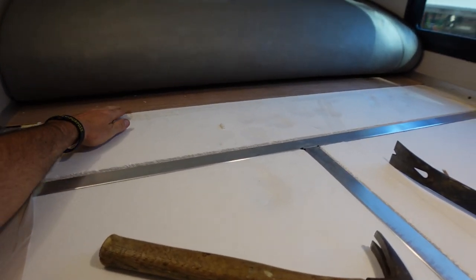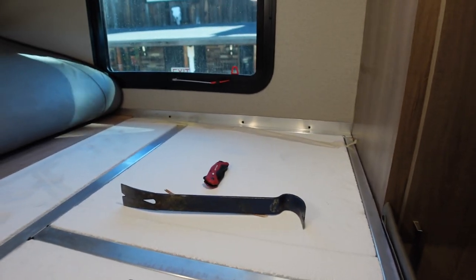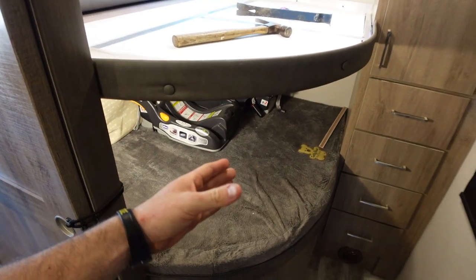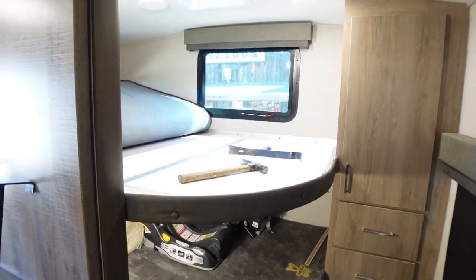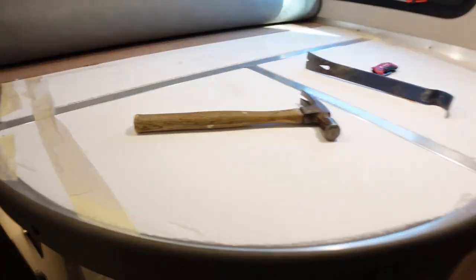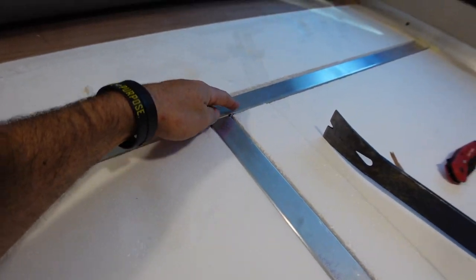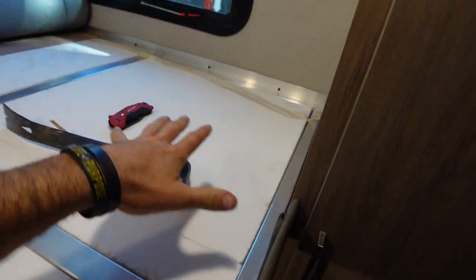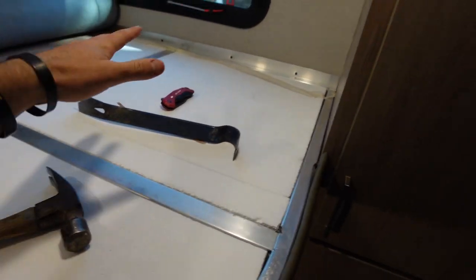Looking underneath, I'm probably going to have to do something like this trim piece the same on that side, but I'd like to keep the bottom looking nice. I pulled up the piece of balsa wood that is on top. I didn't realize it was going to be made this way — basically it's aluminum frame, foam, and balsa wood on both sides. It's made the exact same way an RV is made. I called the wife just to confirm she wanted me to go ahead and do this, because we want to keep the baby down here, it's kind of hard to get in there, and that's also where we want to change the baby. So here's what we're going to do: I'm going to cut this piece of aluminum, cut the balsa underneath on this line, cut this piece of aluminum and balsa on the line, and then cut it right here. Then I'm going to lay a piece of plywood over the top, screw it into this frame, and basically when we don't want this upper bunk we're just going to lift it up, slide it under the mattress, and this area will be free and open.